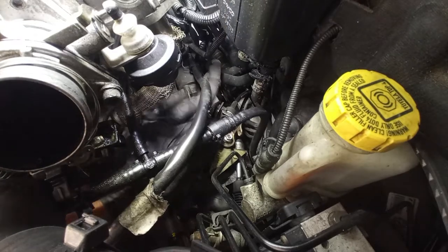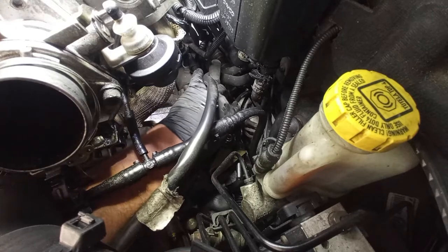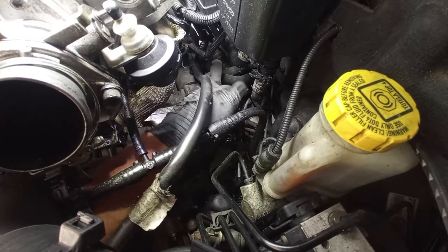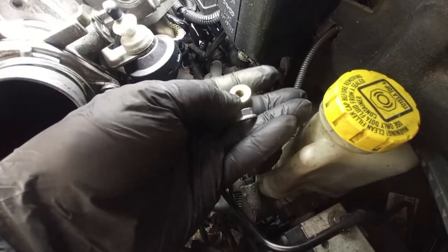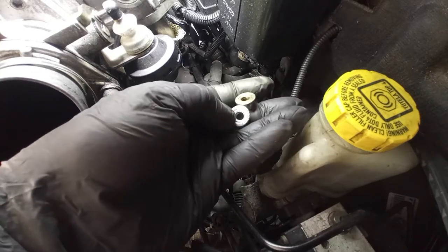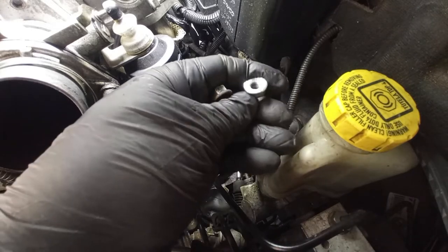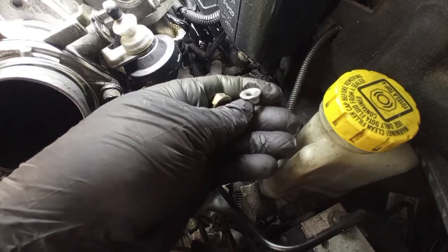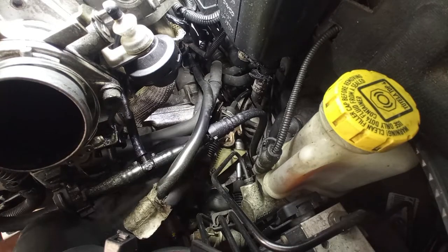I have here one nut that is not from here, but it is very similar. My problem with the fasteners, they are not original. It's just the shape and length and whatever. If the nut is close enough, it is close enough, okay? No problem for me. The only thing that bothers me is this original one is flat and smooth, and this one over here, it is not. So I will put a smoother one, because this one will create some corrosion, because it is very harsh.